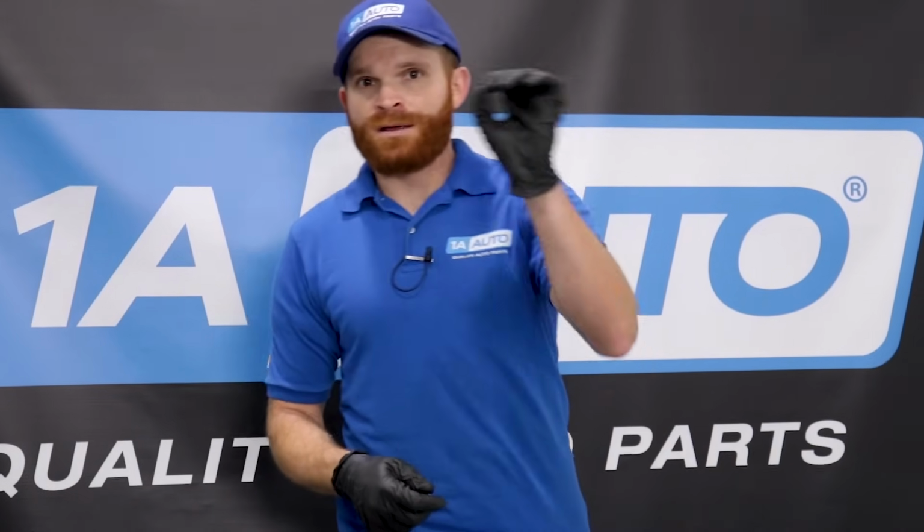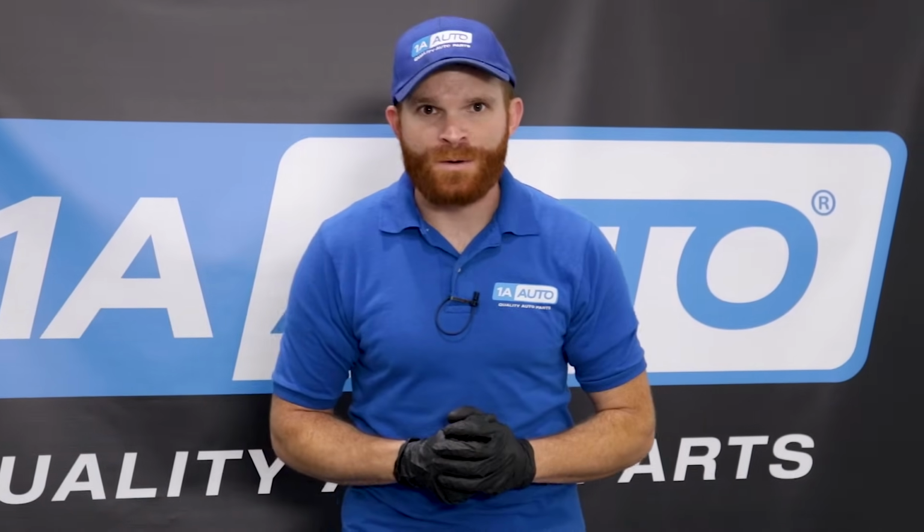And of course they're going to do all the usual tests. Not only do they find that you maybe have low fuel pressure, but they're probably also going to find that you have odd signs of wear on your spark plugs. When you have low fuel pressure, that means you have a lean condition. Once again, that means that you have too much air getting mixed with the amount of fuel that's getting burnt up inside your engine's combustion chamber. This causes your engine's combustion chambers to run extra hot.